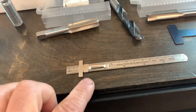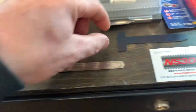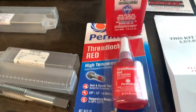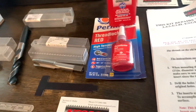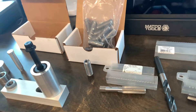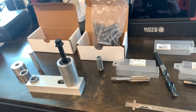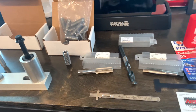There's a nice little height gauge — it's even got his logo on it — so you can make sure you're at the right depth. There's a little T-handle tool for spinning the insert in, and it comes with some tap fluid as well as a full bottle of red Loctite. This looks like a really good permanent solution. This kit is specifically for the Kia/Hyundai 3.3, and it does come with 17 inserts — 16 the vehicle takes, and then one extra.